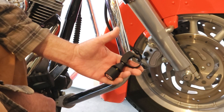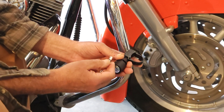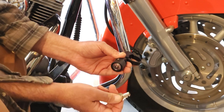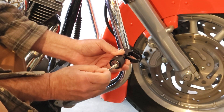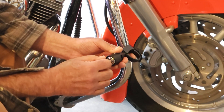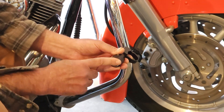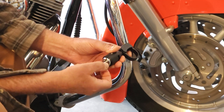This comes packaged like that in your kit. First, we're going to disassemble it. We didn't tighten the set screw in the kit that holds that lock core in — it's threaded in there. We're just going to use the key as a tool. The key has a little ridge on it, and there's a little slot in the lock, like all barrel keys. Put that ridge in the slot just slightly so we can unscrew this lock — because it's flush like that, you can't grab it without the key.